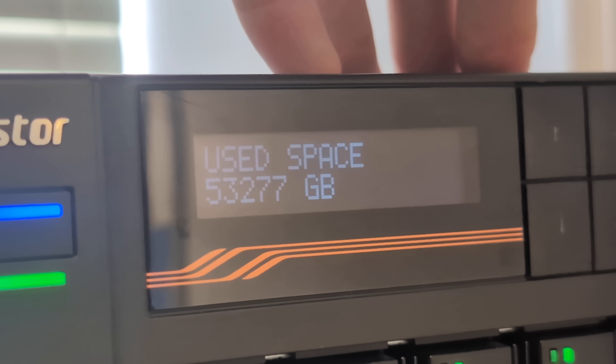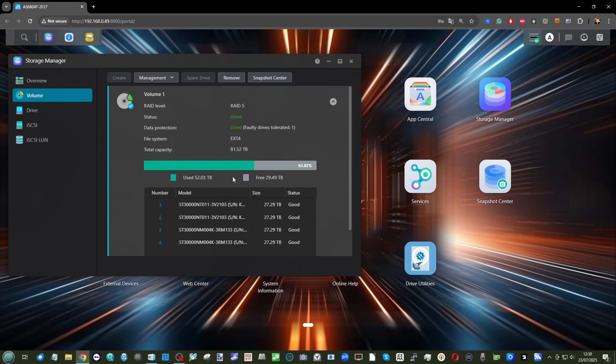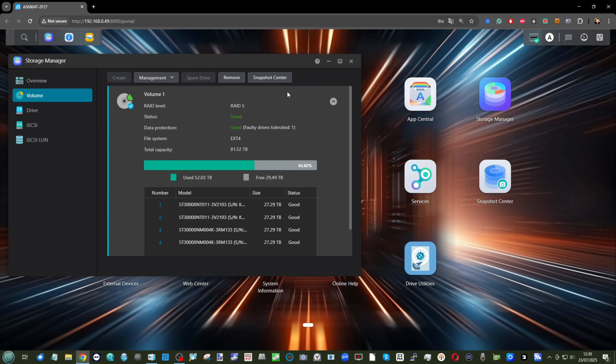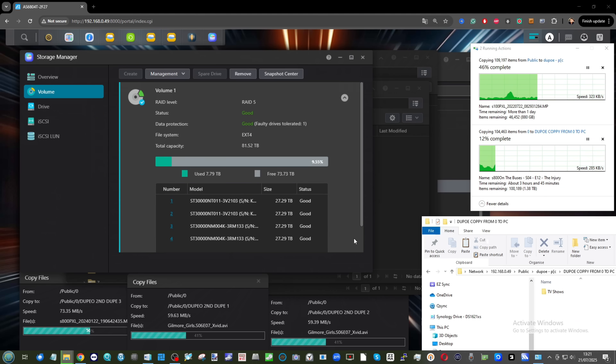That happened around noon on the 23rd of July, and I ended up with 53.02 terabytes of space occupied on those discs. I did that with backups running inside and externally on the system, as well as creating new directories with data moved around — it wasn't just reusing background duplication; it was fresh data every time. That took two days and three and a half hours of real-world data movement. Once you added it all up, we were still hitting around 200 megabytes per second to write all that data. We got to 63% utilization and I was ready to do the RAID rebuild test.